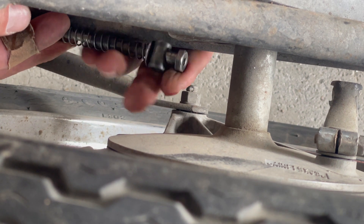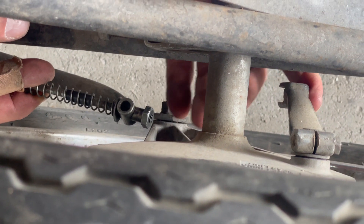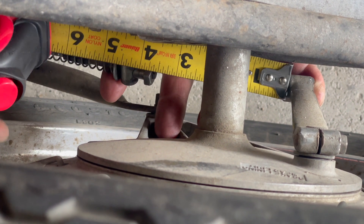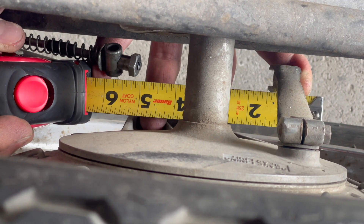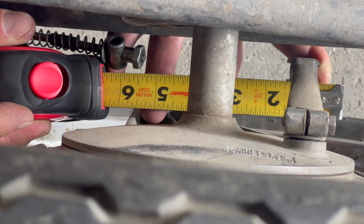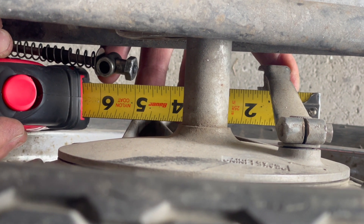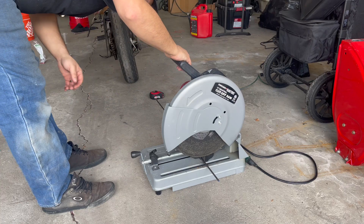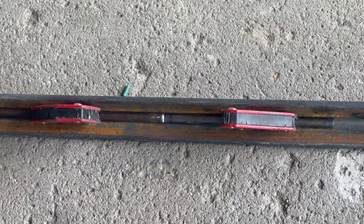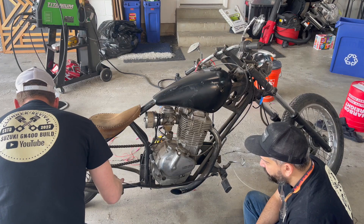That's a little bit of death pull right there — a couple inches out of size. So we got a five-inch stick on there, it'll put us a little bit out the back, and we'll push it to five and a quarter. Here you can see we're adding a five and a quarter inch section of metal rod, then we re-weld it, grind it down, and put it on the bike.